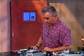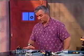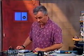That one's in — you'll know when it's seated properly because the white clips will be in the same position as the other closed ones, and it'll feel firm. That's one stick — all we're putting in for now — but you have room for expansion. It's good to know how to do this because down the road you may want to add more. There's other stuff that's going to go on the motherboard: video card, sound card, modem — but I'm not putting those in yet.